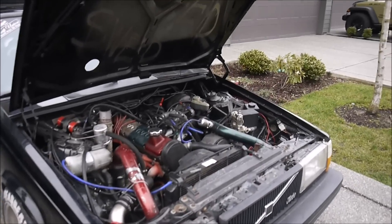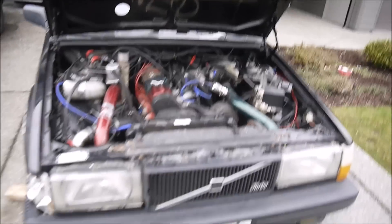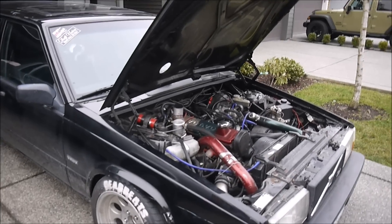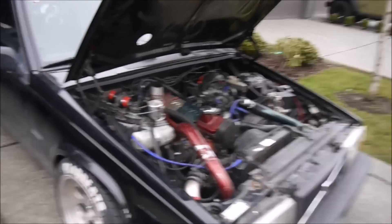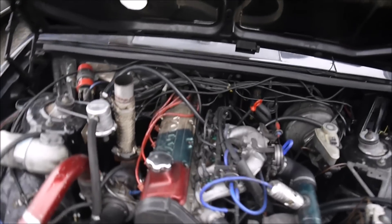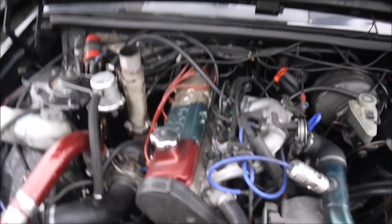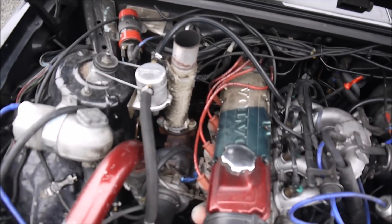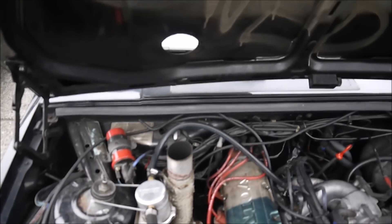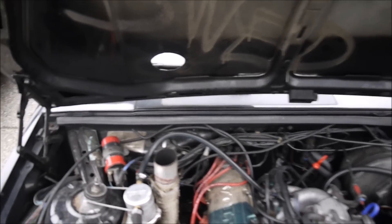What's up fellow car enthusiast humans. Just doing a walkaround of my Volvo 740 turbo drift car — the one I use for most of the events up in Penticton and that kind of thing. Going to go over the setup: it's pretty simple — B230FT with an IPD turbo cam, T3/T4 turbo, 90 manifold, boost controller, eBay intercooler, and a hood pipe, because that's always fun.